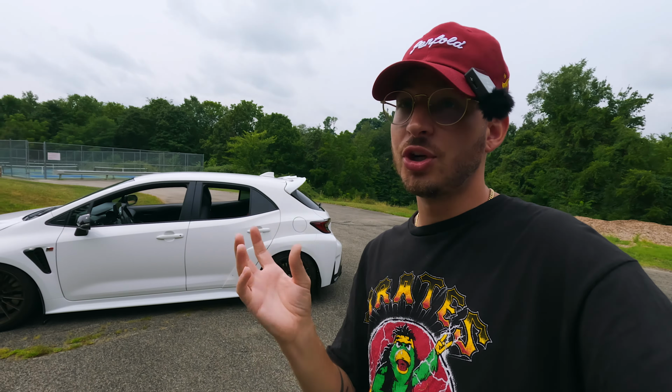Another thing is that I'm seeing people put the rear bump stop that's in the kit on the front. Oh my gosh. I can't believe this. Like, I mean, it's not my car, but like, gosh. And these videos are out there, and I just really hope that you guys are not watching those videos and doing exactly what they do. Hopefully you paid attention and realized that they did it wrong, because they're just screwing up so many people, and all of your ride qualities are going to suck if you do that.